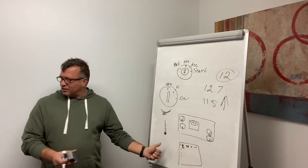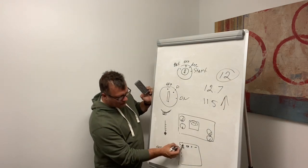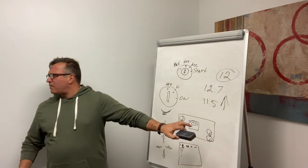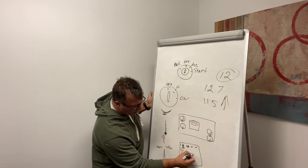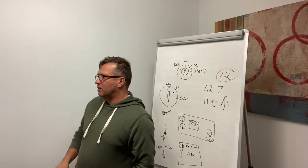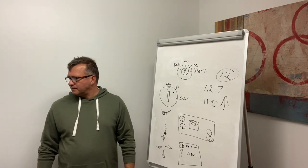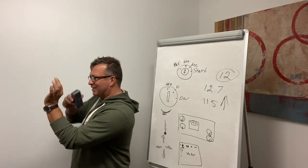There are arrows on the steering wheel. You choose left and right until you get into the home screen, and then you go up and down to choose the first page. There will be some information, but what you're interested in, in the very middle, is the voltage, 14.1 volts. If it's not there, if somebody changed it, I will set it. This is the voltmeter. On the older vehicle, there is a voltmeter gauge.